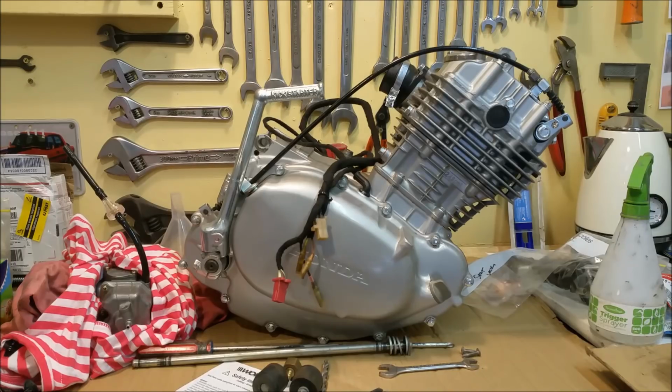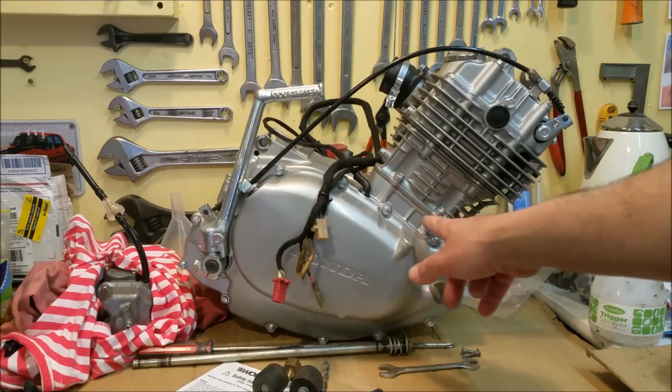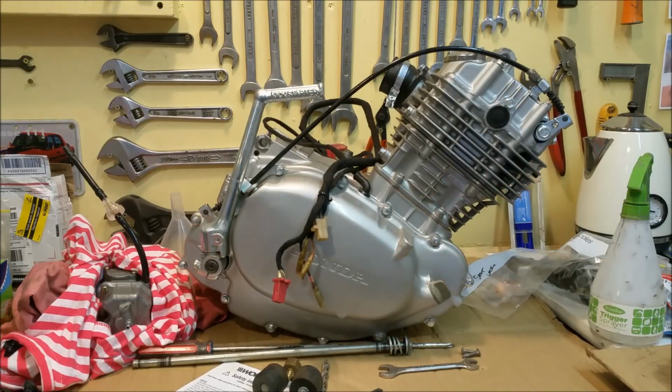Now, this XL engine I've had apart a couple of times and failed because of a noise in it. To curb that, I checked the compression height of the new piston. We put a new piston in and honed the bore. And to combat it, which was only really ever a band-aid, I made a 1mm thick copper spacer. So that's going to have lost a lot of compression.